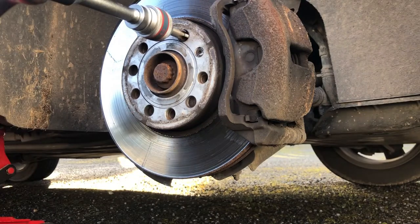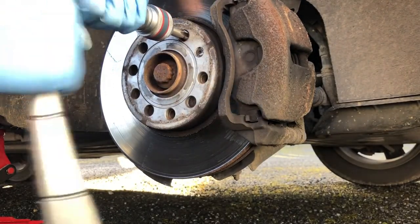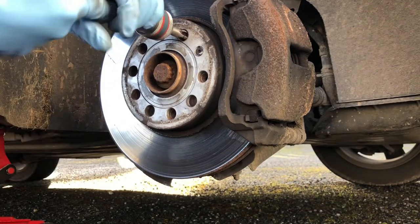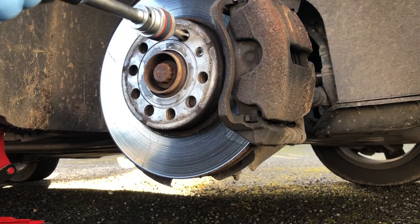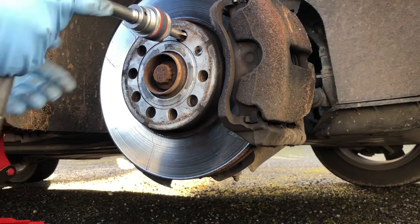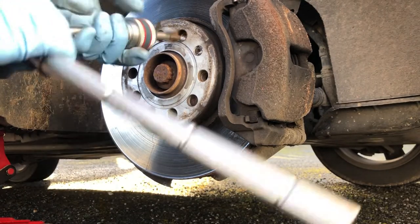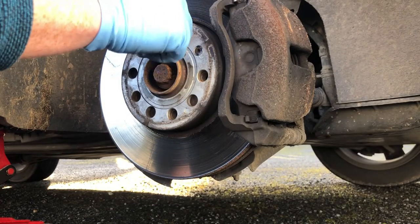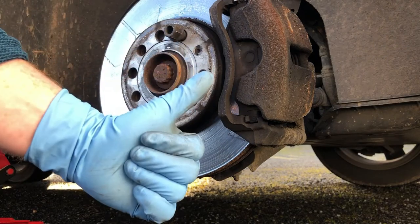We're pretty much good here — just keep repeating the process until you're happy. Now pulling the tap back out after finishing. You'll see all the burrs coming off as it unwinds. Just clean it out, and now you'll see the thread goes in nice and easy, just like the rest of them. There you go guys, see you next time!